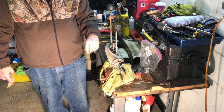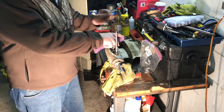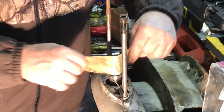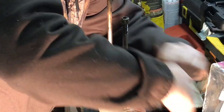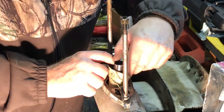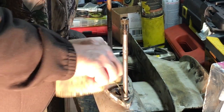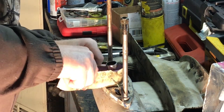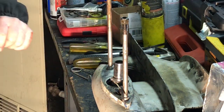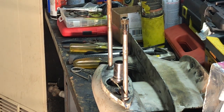I'm going to clean this up, put the new bearings on, and see how it goes. I think it'll clean up okay — I can barely feel the markings. I'm going to sand these down a bit and polish them up. Trying to avoid taking the lower gear housing apart. I'm going to edit until I'm done with this portion.